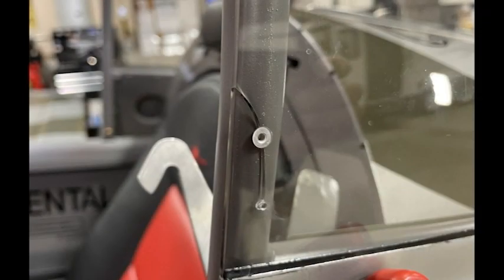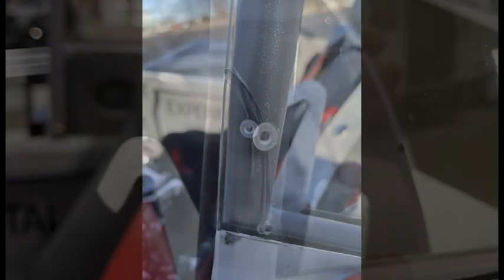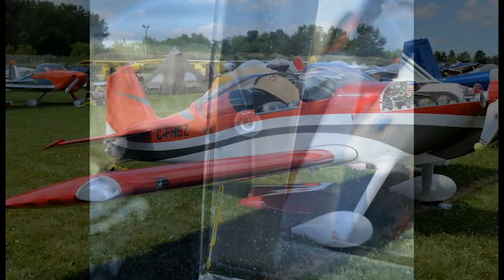What we're trying to do is prevent cracks. It's not to say that you can never get cracks with Sikaflex, but you can see here where there's a hard fastener and a crack has started. It's a very common thing on RVs — you've got big temperature variation and a lot of pressure on the canopy.